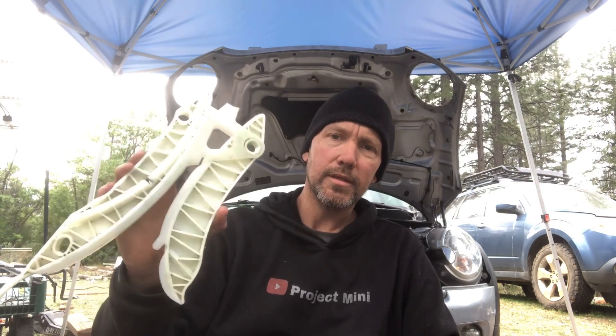My timing chain video is actually one of the longer ones on YouTube because I did it when I was new and showed every bolt the whole time. That two-and-a-half-hour video is how long you'll actually be working when you change your timing chain. So don't be afraid to buy any Mini Cooper, especially the N14, because of plastic timing chain guides — they all have plastic timing chain guides. The timing chain was only an issue before they updated the tensioner, and if you buy a cryo-treated one from Detroit Tuned it's going to come with the new tensioner and it won't be a problem.